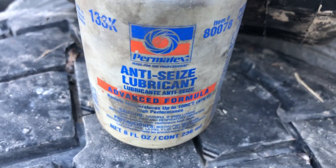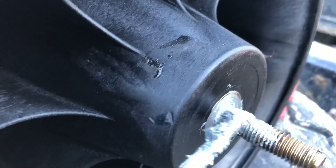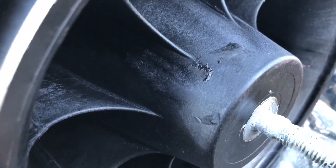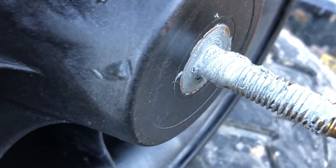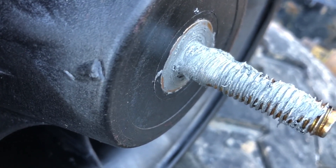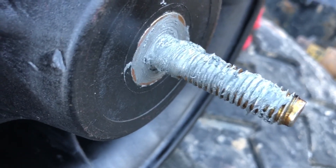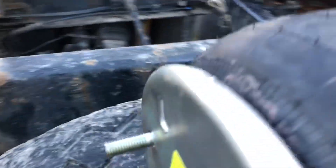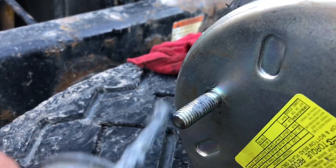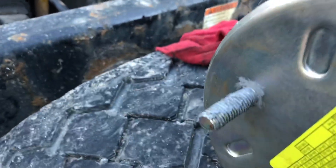I'll explain what anti-seize is — I've just put some on the threads. It comes out with a little brush and you just paint this stuff in here. What happens is when you put this on your threads and put the nut on over top of it, it's going to help keep your nut and whatever threads you have from either rusting or corroding. So two or three years from now if this thing needs replaced again, you can actually just unscrew it. Make sure you do the top and the bottom — it doesn't take anything major, this stuff is very simple and easy to apply.